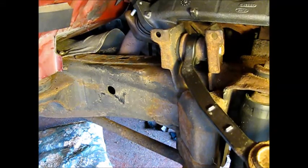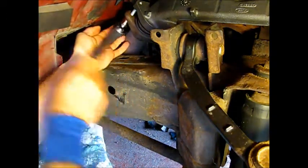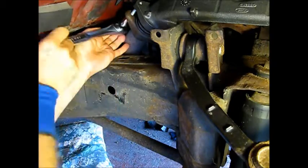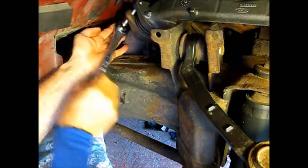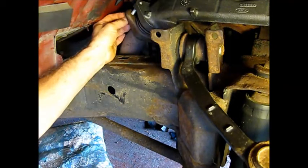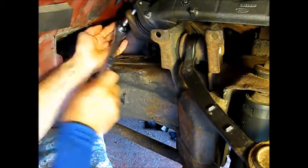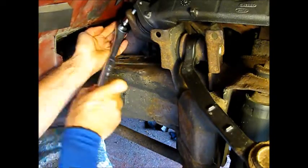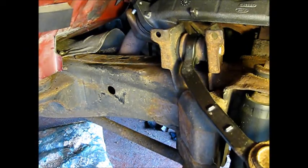Up on top here, use the direct approach. Keep them even — looks like we have a little bit further to go on this one. That's the idea: 25 to 34 foot-pounds. And we'll be testing this out.